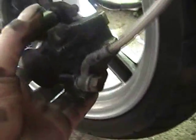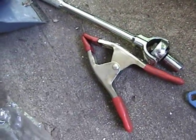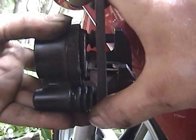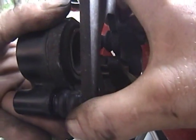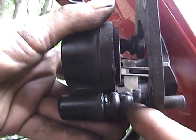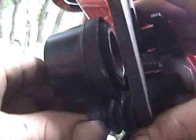After we get that in, simply take the caliper, put it back on, bolt it up, and we're done. You'll have to compress in the piston — you could do it with just your thumb; two thumbs is a little easier. We want to make sure that our slide pins are nice and smooth. Check the rubber boots and make sure there are no rips in them. If you accidentally pull off a boot, make sure to get it lined up and nice and snug, secured in its spot.